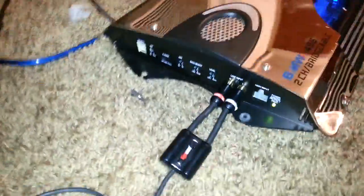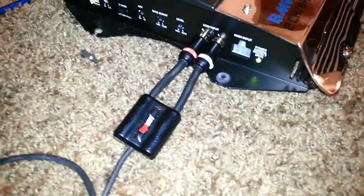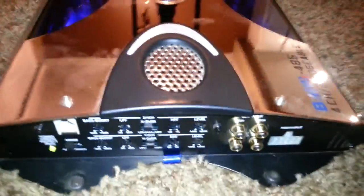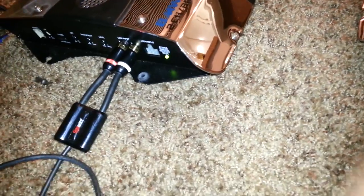So yeah, that's basically how it's done. I got this little splitter right here and a remote wire. That's pretty basic, but some people don't know how to do it, so I'm just showing you guys. On the back of your head unit you should have an output for a subwoofer, which is left or right. And then the 4 channel output for this amplifier is usually in the back of the stereo too. If not, you can get a splitter and split them, then get RCAs right into each amp.